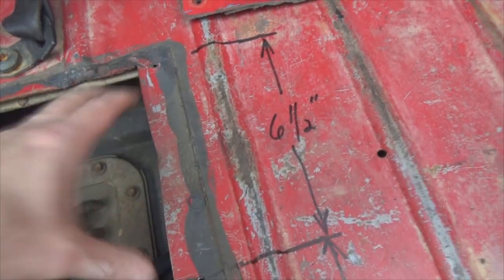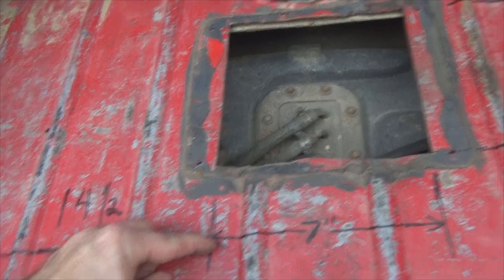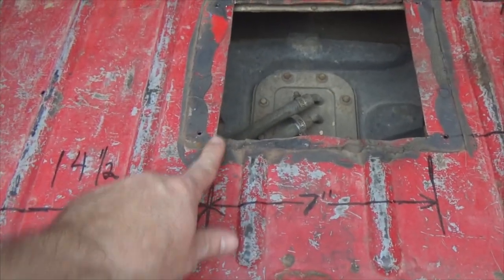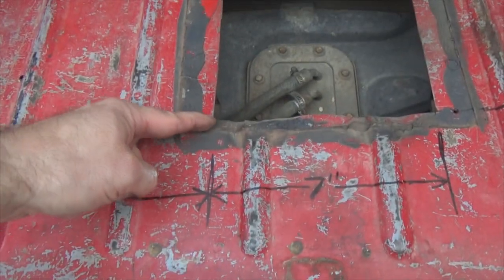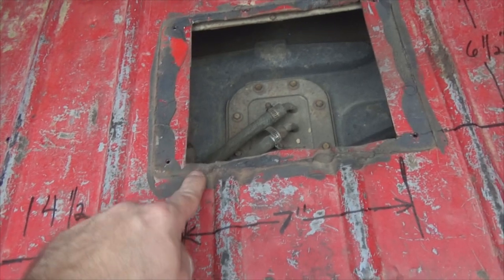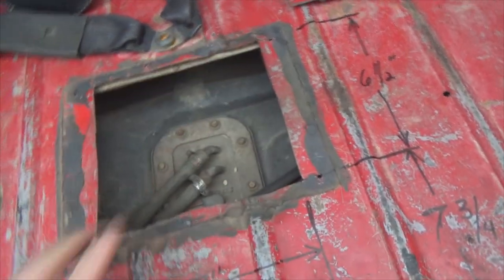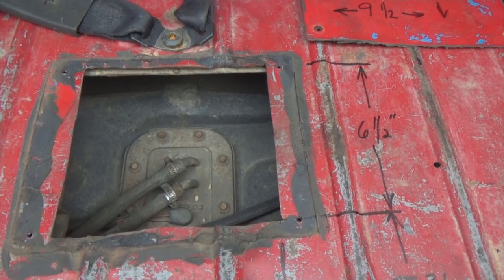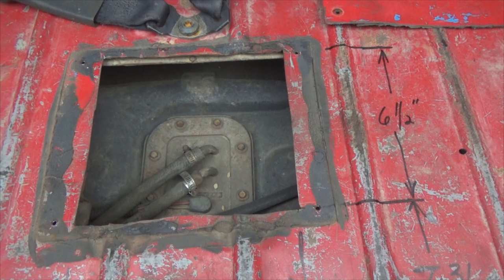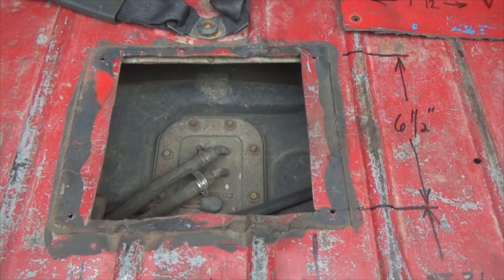Those dimensions should give you what you need to locate your hole. Measure fourteen and a half inches across, make a mark; seven and three-quarter inches this way, make a mark — you'll find your corner. Make an X right there: fourteen and a half inches over, marked seven and three-quarters from here to here, that locates your corner. From that corner, measure over seven inches, then measure up six and a half inches, draw your rectangle — that's where you cut. With your gas tank out — please, with your gas tank out. I am not in any shape, form, or fashion responsible for anybody blowing themselves up because they forgot to take the gas tank out.